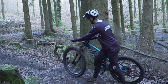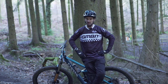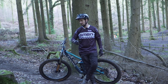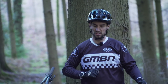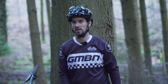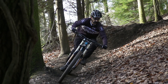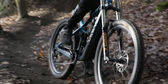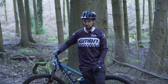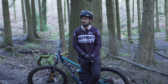For me, wheelbase feels like the biggest difference — but if you're going straight through rough stuff, wheelbase doesn't make that much difference. Whereas if you change the head angle by two degrees, I would really notice it. This doesn't feel like a huge difference in isolation. It's only when you add it all together. I've always been really sensitive about front wheel weight and being able to drift a bike rather than just slide on the front. You can't view any one part of a bike in isolation. How progressive your fork is dynamically affects where your weight is. When you're going slow and turning on the flat, it feels different, but when you're riding hard you're only changing one thing and then you feel a huge amount of difference.